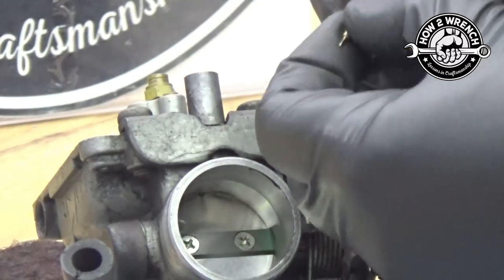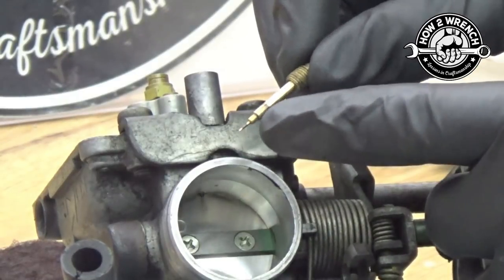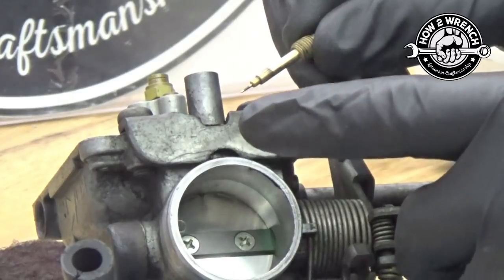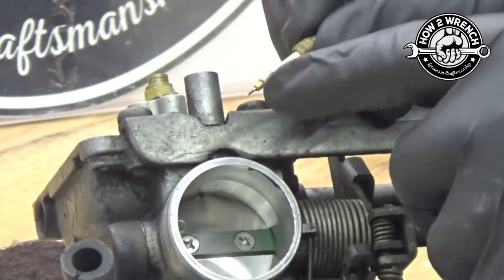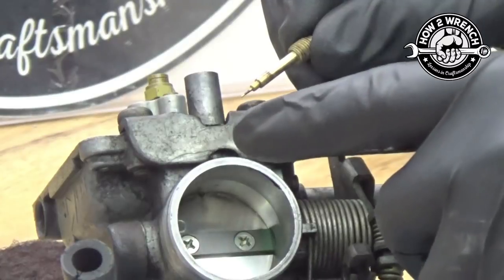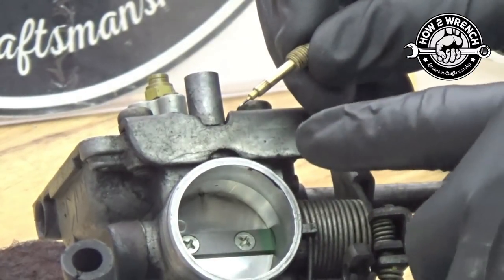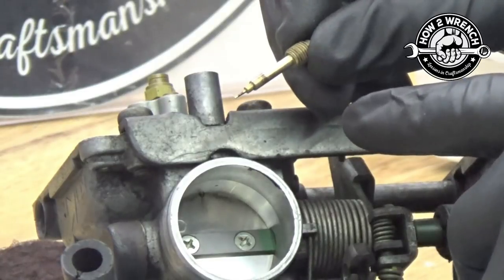See what we're messing with. You don't want to tighten that in really, really tight because you could break off that small point. When it's a fuel screw, it's usually got a really fine point on the end of it. If it's all tapered gradually to a point, it's more likely on the air side. Watch other videos in our fuel systems playlist to get some deeper understanding of that.